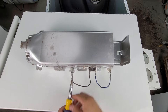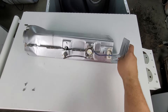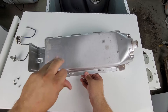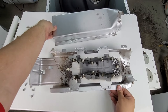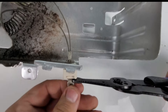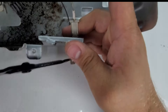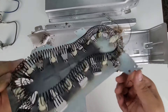Here's how you take the canister apart. First, remove the sensors on the element canister — there are two screws on each sensor holding them in place on the housing. Once the sensors are fully removed, remove all the screws holding the canister together; there should be approximately six Phillips head screws. Once removed, you can open the top of the canister revealing the electric heating element underneath. The element wire connectors have two tiny tabs, one on each side, bent at an angle to keep the connectors in the ceramic block. Use pliers to pinch and move these tabs flush so you can remove the old element wire from the heater canister. With the connectors out of the ceramic holders you can now pull the element out — it's been completely disassembled.